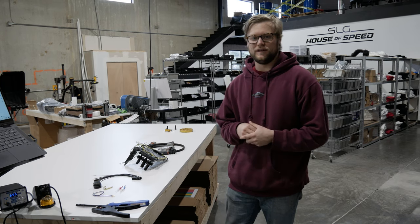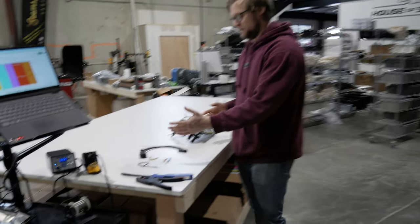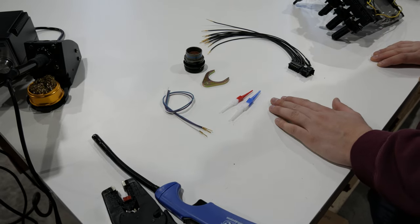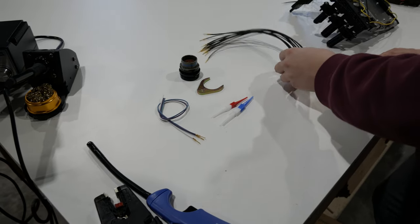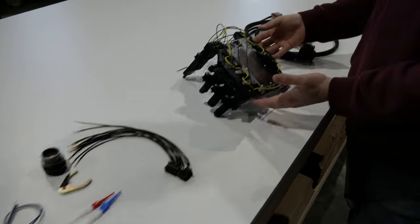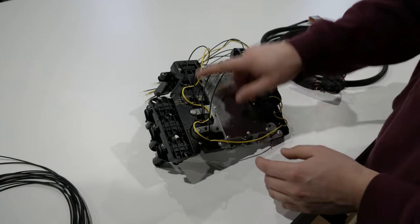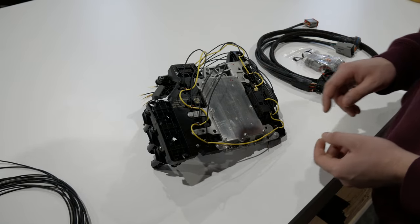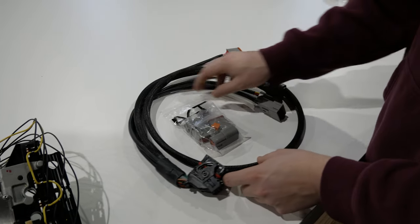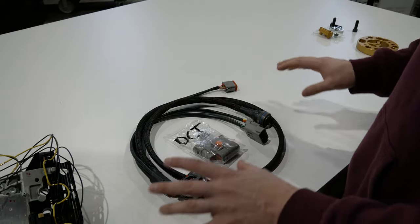Welcome back. It's been about two weeks and you just received back the wiring kit from us. This is basically what's going to be in the box. You're going to have three different little wires you're going to be soldering. You have the main connector you're going to push into the transmission, some de-pinning tools just in case, the mechatronics with all the internal wiring done inside, and then all the solenoid wires. We wire directly to the solenoids to achieve the strongest valve tests. And then the super nice harness we make — all the best materials, motorsport grade. You'll also have the other side of all the connectors, so there's nothing else you need to buy.